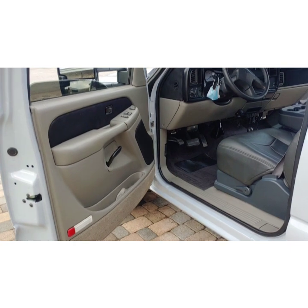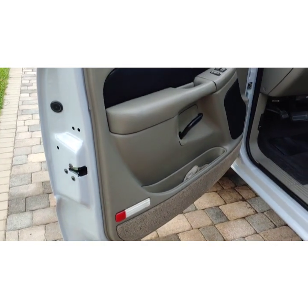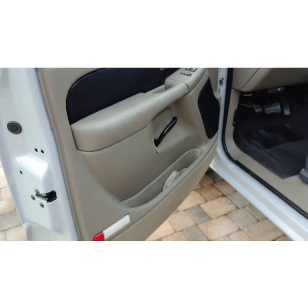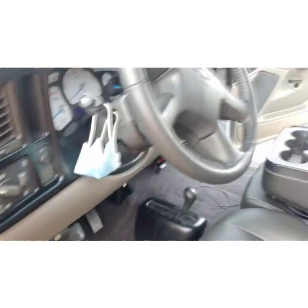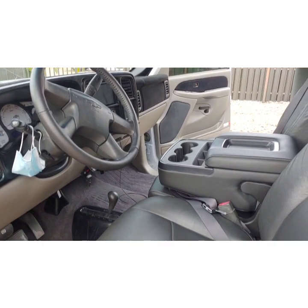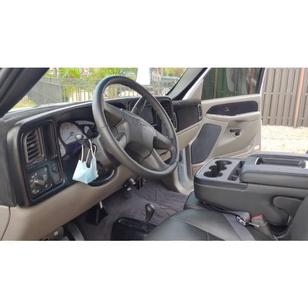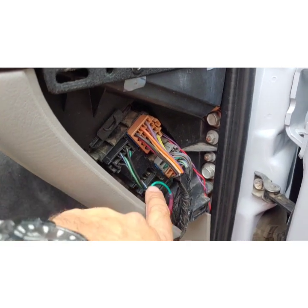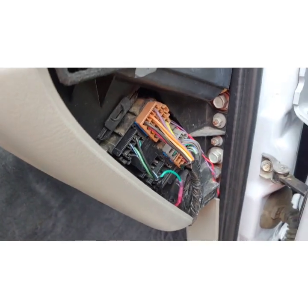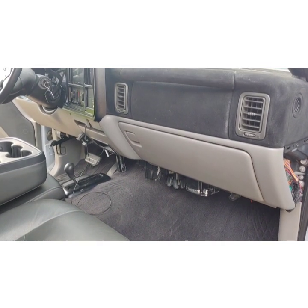It's a little later than I wanted and I didn't get a video of installing all the window regulators and door lock actuators, but there's really nothing to it — the same way the old ones came out is the same way the new power stuff goes in, and you just connect all the wiring harness. However, for the passenger side the two places I found power had problems: one only gave me power when the lights turned on automatically at night, and the other one was in and out with the power. So what I did was disconnect it, splice it, and ran a power wire to the other side — to the junction box underneath the driver door — and I'll show you where I tapped in there.